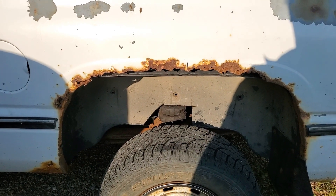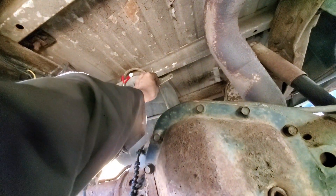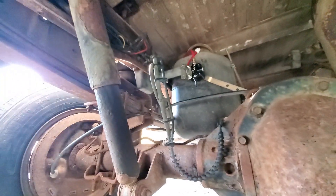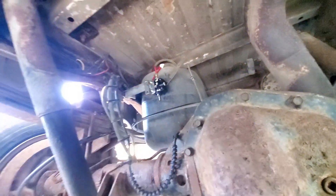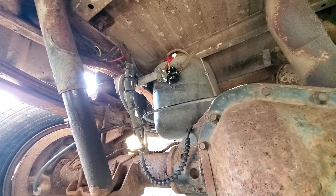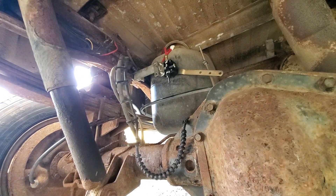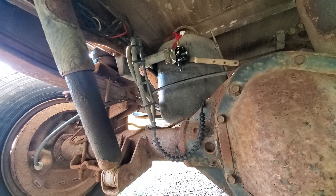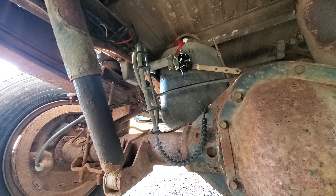This is the auto level valve under the truck, all finished with air in it. I'm going to take the arm off and work that valve up and down to show you. I'm dropping the air — you can see the suspension going down. If I want to raise it up, you can see how high it goes. The idea is just to get the truck to ride at a certain ride height when I'm pulling a trailer, because sometimes with weight I was hitting the bump stops. This should cure the ride height problem with a heavy load on a trailer.